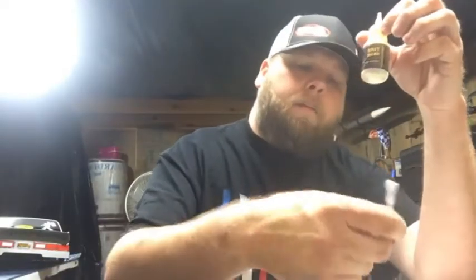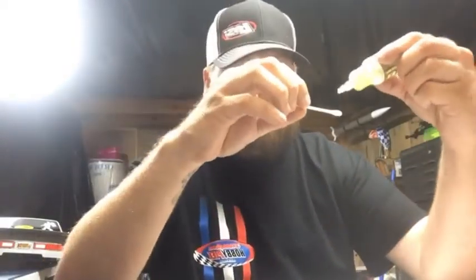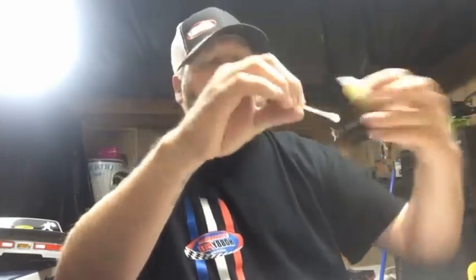So I told you that you would need a scouring pad or something. We did that. We smoothed out just a little bit of edge. I also told you you'll need some CA glue, maybe some heavy, some thick, some thin. It's whatever you like to work with. CA glue, cotton swab, Q-tips, whatever people call them. What I do is I take some CA glue and put it on the Q-tip, just to get it a little wet. And I use a thick so that it holds to everything and nothing runs off.